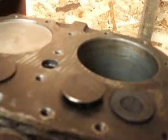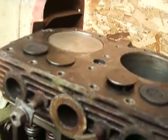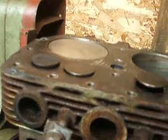The cylinder — it's a three-and-a-quarter-inch cylinder, two of them. I checked them with the micrometer and they're pretty much bang on, maybe half a thou over.